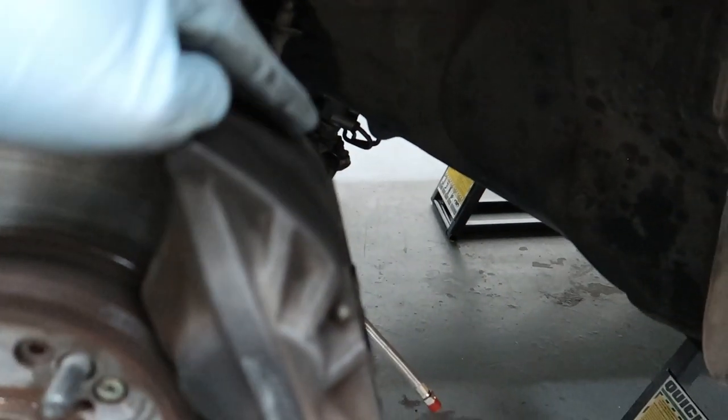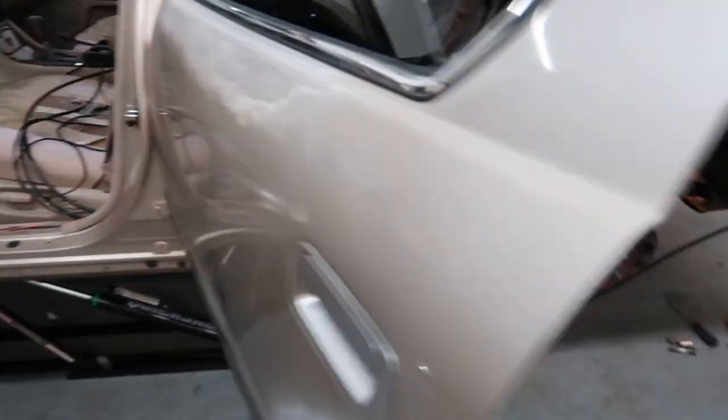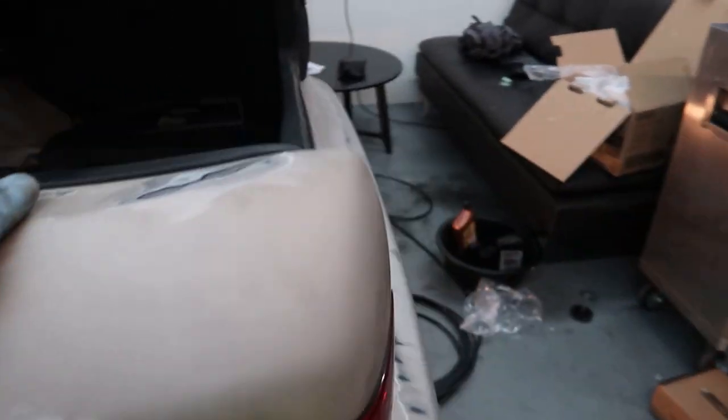Welcome back to the second portion of the video where we'll show you guys the final install for the Lexus build. Huge shout out to Casey the owner of Stance Quarters, and huge thank you to Pierre — without Pierre coming out I wouldn't be learning anything today. Here's an update: the front bags are installed, everything is tightened up, we have the leader line going in, we need to make a hole going into the firewall. The harness is running through here. We undid the top hat bolts for both driver and passenger side. We're going to run the tank and two compressors on top of the rear lining.